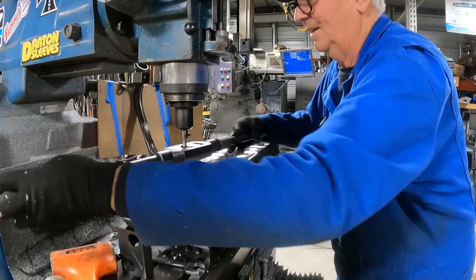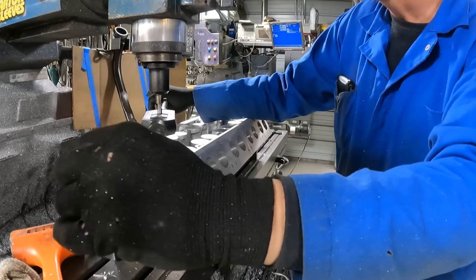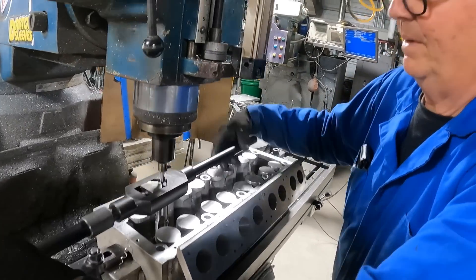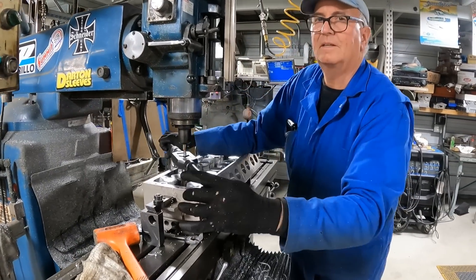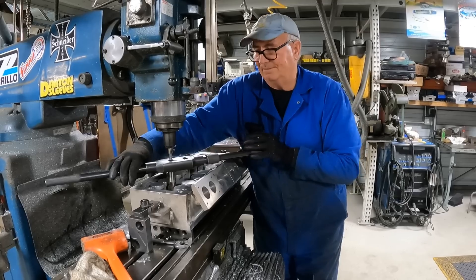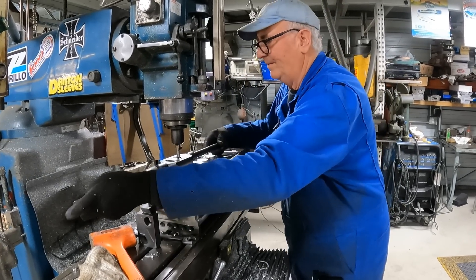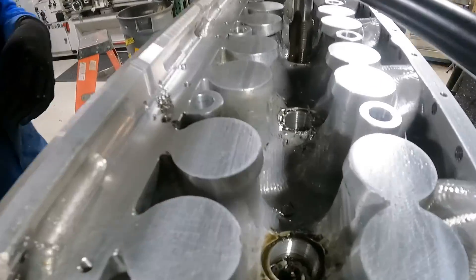So I'm assuming you did the surfacing on the bottom and the top of this one already too? Well, I haven't set the depth for the back of the spark plug because I want to get the chamber done so I can set the height for the reach of the spark plug. So I'm going to do the chamber and I'll come back in here and spot face that to get the right depth. That's what they look like when they're done.